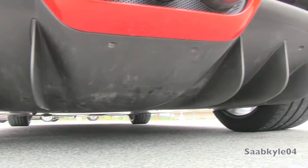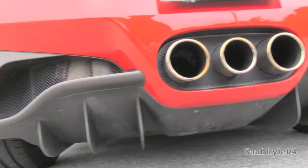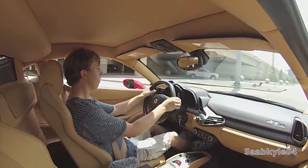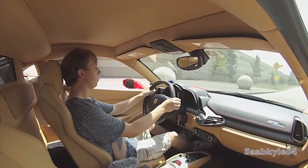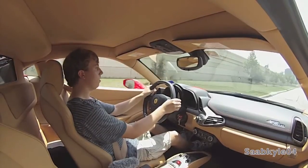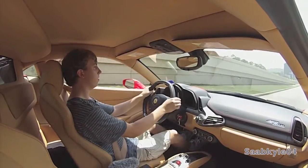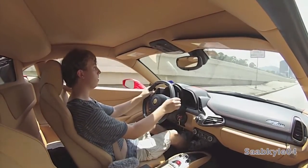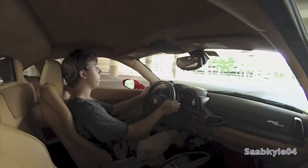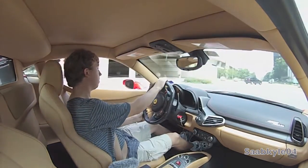Compared to its predecessor, first employed in the 599 GTB Fiorano, the new setup brought a revised ECU for a 50% reduction in input time and a force generation time of 8 milliseconds compared to 15 milliseconds. A new piston rod bushing in the damper further reduces friction by 35% for more precise small bump control and improved ride comfort. Being that the eDiff and F1 track control software are integrated into the same ECU, they also communicate with each other far better, integrating actions with one another regardless of which mode you have the Manettino dial twisted to.